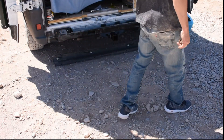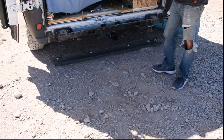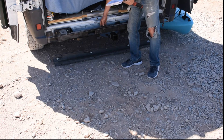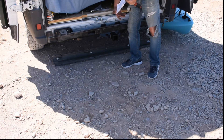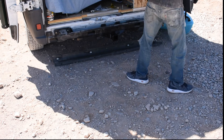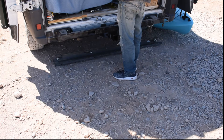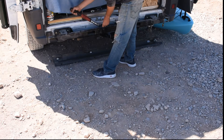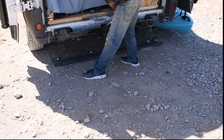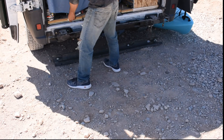We're going to grab our torque wrench. The half-inch hardware is going to be torqued at 110 foot-pounds, and our 10mm hardware will be at 48 foot-pounds. Our two half-inch bolts are here, and then it looks like everything else will be at 48 foot-pounds. Here's where that crow's foot comes in — you'll set your torque to 110 pounds for those, and for the rest of them we'll put 48 foot-pounds on.